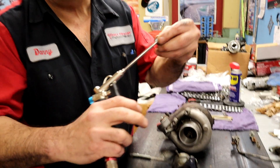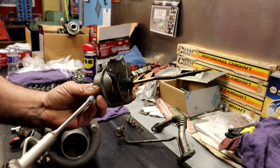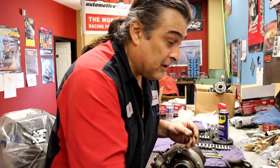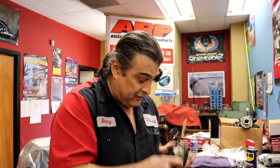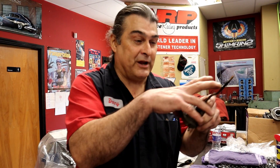We could put a gauge here and see how much pressure we have. This is what's happening — when it goes into boost, it does this. You see that? When it goes into boost it opens up, goes out of boost, it comes back up. We just tested the wastegate and we know we have a good wastegate. I can't tell you right now at what exact pressure this wastegate is set, but we could put a gauge and start turning it up — as soon as it starts to open, we know that's when the wastegate begins to open. That's why we would cut these rods and shorten them to put more preload and increase boost. But what you're doing on this side — this hose — you actually put a little manual boost controller in there. What you're doing is bleeding off some of the pressure so this doesn't open. As opposed to putting a heavier spring, you're just changing it over here. All acceptable. There's the wastegate — we know it's good.